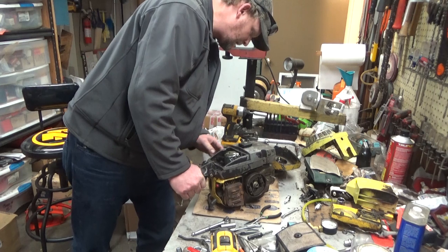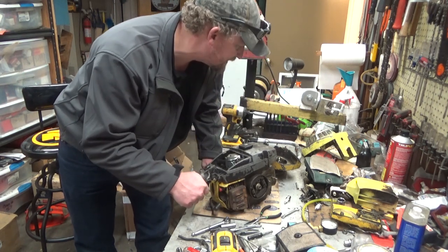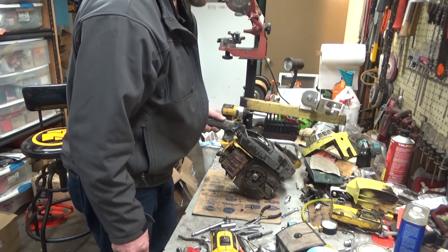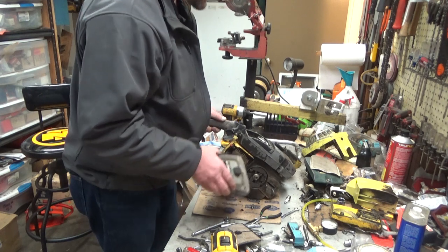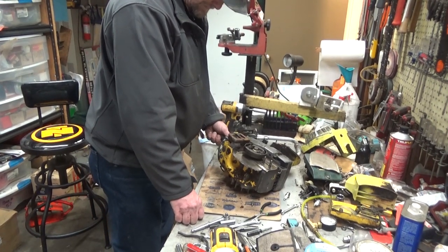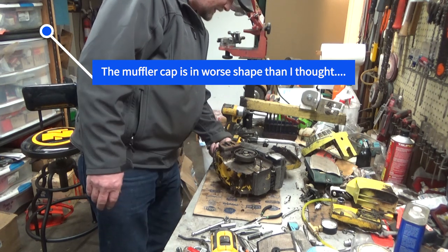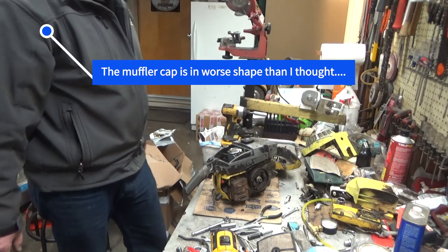So, anyhow, I don't know these saws well enough to know if I'm looking at a true SP81. I know they didn't all have a compression release back here, so that's a step in the right direction. I don't think McCulloch put model numbers on anything but their air cleaner covers, but I know this cover is unique to this style of tank, which is going to be unique to this series of saws. And I know that muffler, as I'm recalling, looks about right. It looks like crap, but I can clean that up. I'm going to say I'm cautiously optimistic that I've got a true SP81 here. If I have to go all the way into it, I'll measure the cylinder bore, and that'll tell the story, just so that I can be certain.